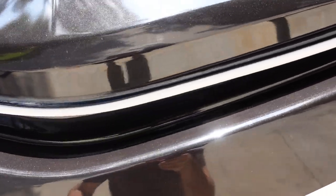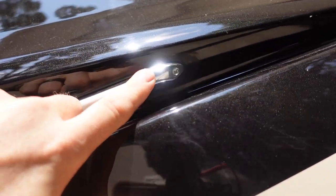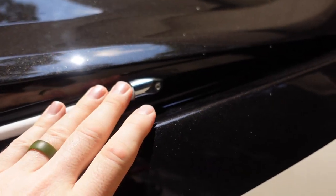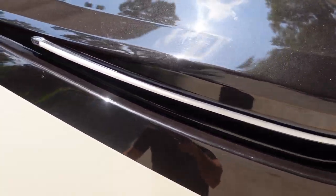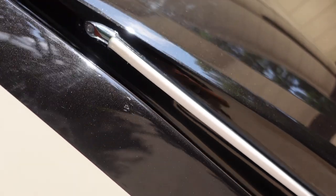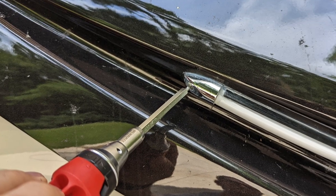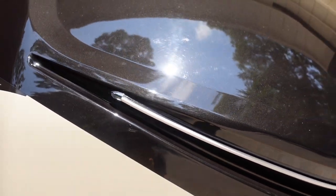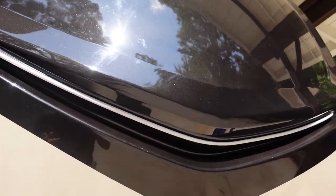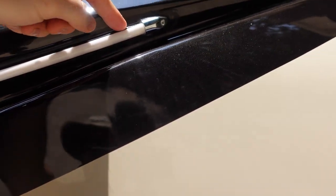If your light hasn't failed yet on your Pinnacle or North Point, there are two things you're going to want to check. First, make sure that both ends of the tube are sealed with silicone or sealant entirely — going into the vinyl tube a good half inch or so, filling the entire void of both ends so there's no possibility water can get inside. You can do that by removing the little chrome-colored caps on either end. Once you remove them, you'll see how the vinyl tube needs to be sealed up on either side.